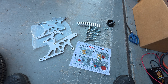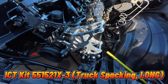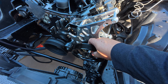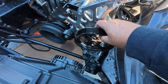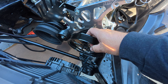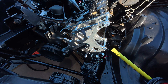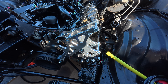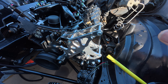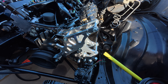The brackets and everything is mounted up. It's a good thing I did this, because now that I'm checking everything, apparently the power steering pulley is not going to work — it's going to hit the bottom here. I thought we had enough clearance; obviously we don't. So this won't get pushed under. I'm about to order a different bracket and I'll keep you guys posted. But the reason I did this is to show you: this is how a bracket comes — a lot of people like to powder coat or paint them — and I'm going to show you why that can affect how your alternator works.